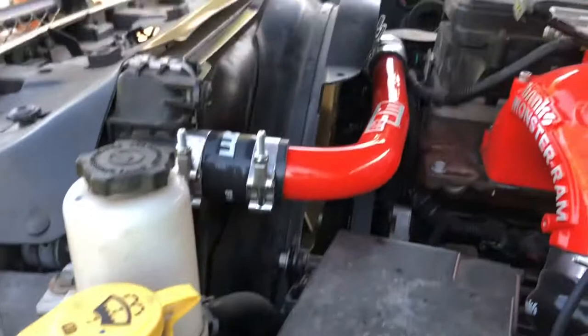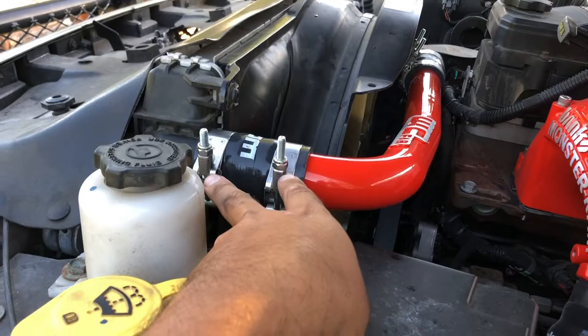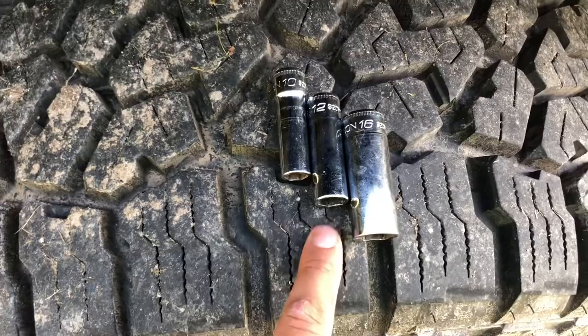The way I found is just send it — pull that upper radiator hose off real quick and work fast. The new clamps are 12 millimeters. I used my impact and snugged them up good and tight. You can use grease to lube up the hose and pipe to help it slide on easier. All the tools you need: 10 millimeter for the bracket, 12 millimeter for the new clamps, 16 millimeter if you want to take the bracket off, and a pair of channel locks.